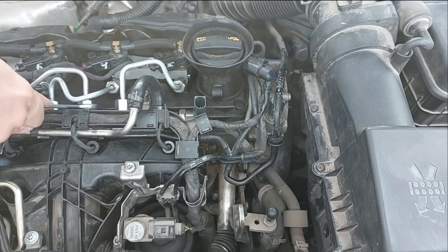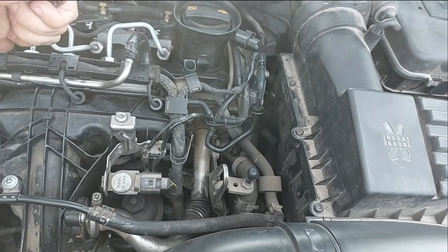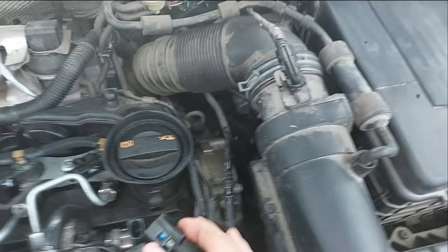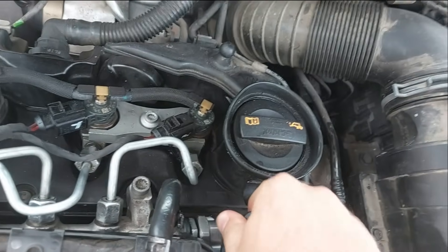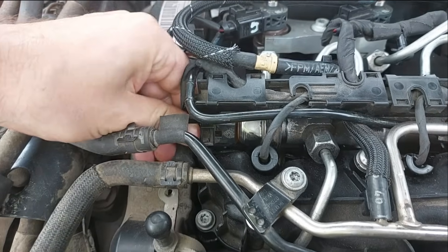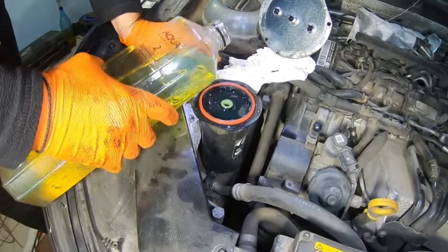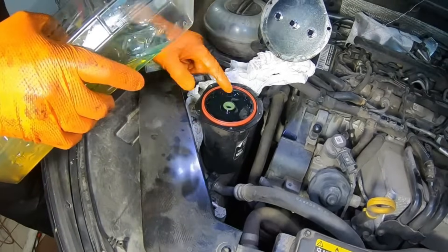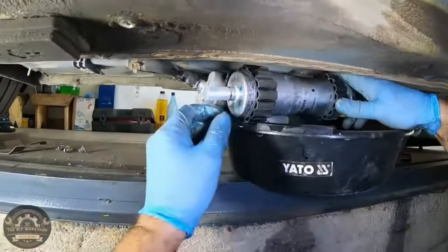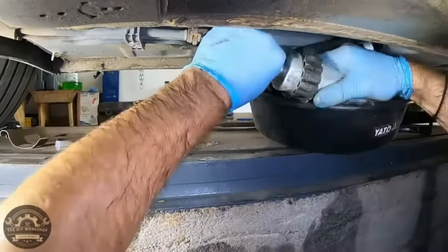After any intervention in the fuel system, or even after a simple fuel filter change, it's important to bleed the system using a tester. Many of you asked if you really need a tester to bleed the fuel system. I believe it's absolutely necessary to avoid damaging the high pressure fuel pump or the injectors. In this vehicle the fuel filter housing can simply be filled manually with diesel, which helps with faster startup. However, cartridge type filters like this one cannot be primed manually, so I'm going to show beginners how easy it is with a tester.